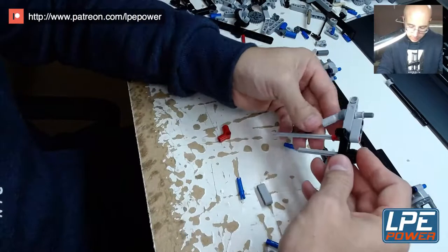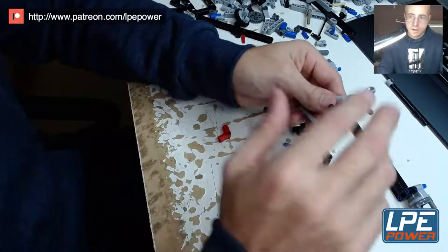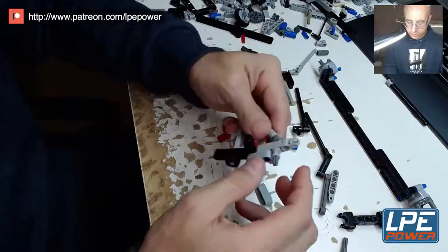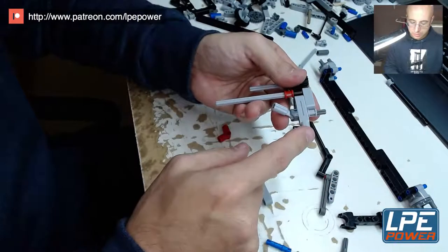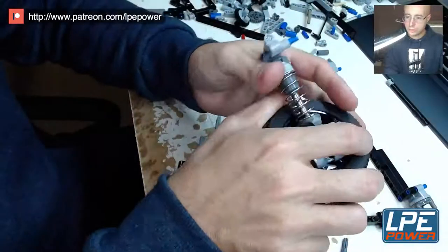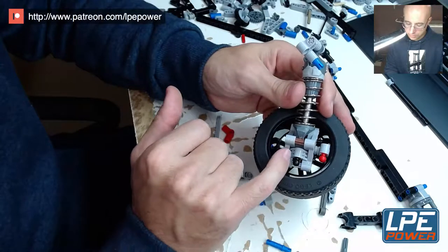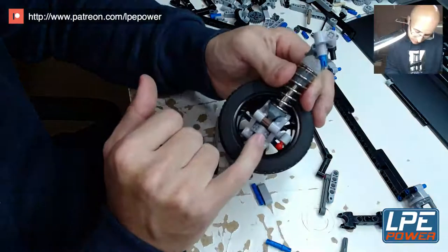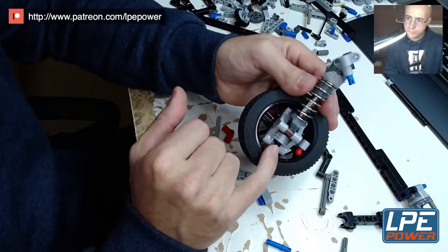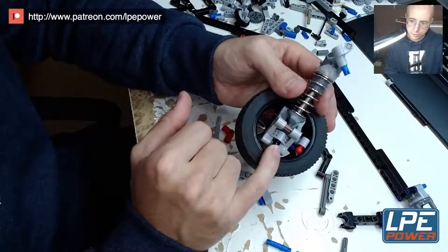And I think it's gonna look almost like Sierra front suspension. Almost, not quite, but we have to make some compromises, because ideally we would have the link turned around like in the charger, but we can't because there's just no room here. If we turn this around, this ball joint would be one step higher. It would basically be just one step lower than in the charger, and I think that would be too high for the Sierra. That would not be in line with how the Sierra suspension works.